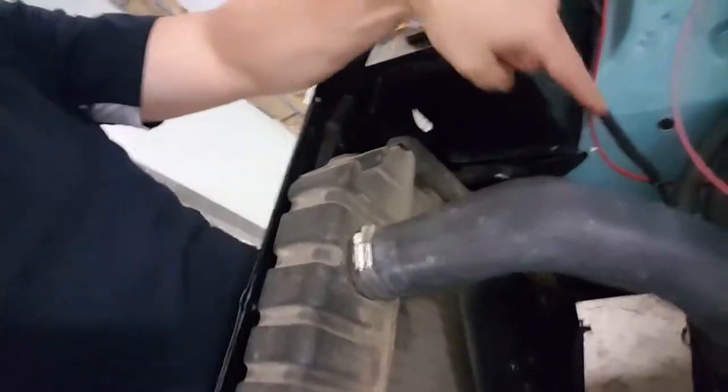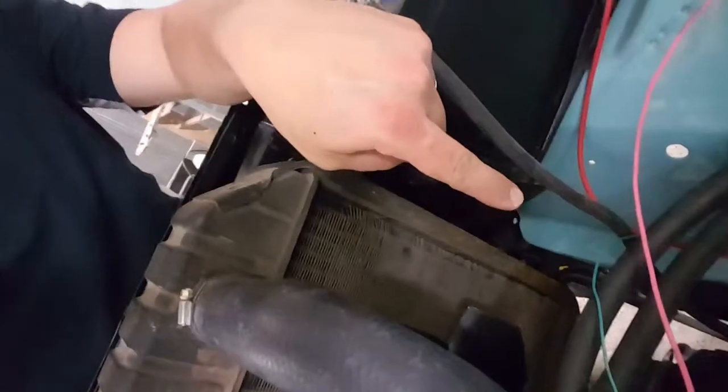A lot of this is my problem — it's my fault. On the instructions, there's a brown wire for the wiring. One side says run it to the alternator, to the one-wire side of your alternator. The other side of the instructions says to run it to the back of your ignition switch for accessory wiring. I followed the first set of instructions, which was wrong, ran it to the alternator wire, and about burned the truck down. Here's some of the loom cover completely melted through.